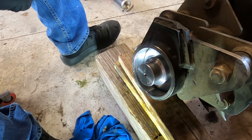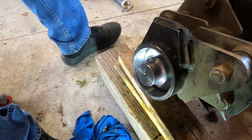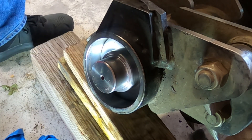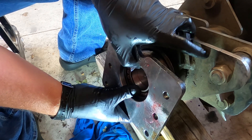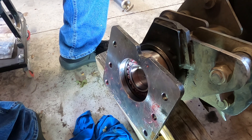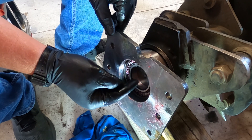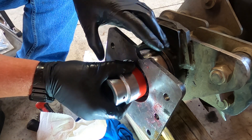Essentially, this side is going to be the exact same as the other side with the exception of the smaller clip and the grease seal on the outside, because it doesn't get either one of them. We want to make sure this is super clean — no debris on it, no old chunky grease. We want to make sure it slides right in there. I didn't figure this side was going to slide right in simply because when I took it apart it didn't come right out, so I got a socket. We'll do it just like when we drove the bearing into the bearing carrier.